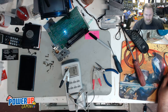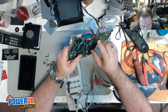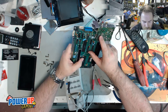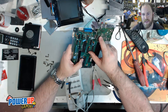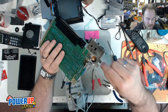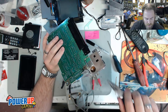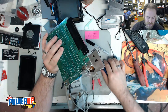I'll be back in a few minutes once I get these organized. So as far as getting them in — I've already got the 10µF in, only because it's an absolute pain. What I recommend is when you actually have them, make sure the legs are longer — the longer the legs the better. When I got my 10µFs I bought them on a tape reel, and what I tend to do is cut off at the tape. I recommend if you're going to cut off at the tape, keep some a little bit longer for this installation. The longer the legs, the better, because you can grab the legs, bend and curl them, and actually aim from the outside into the holes.